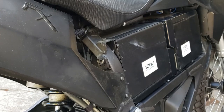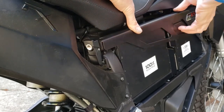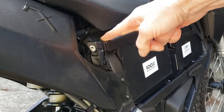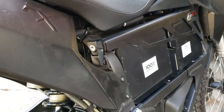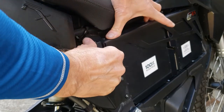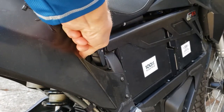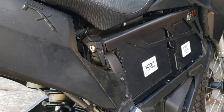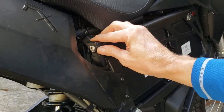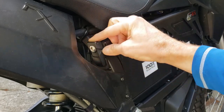Now to reinstall the battery retaining rail, set it in there, push it forward all the way and lift up a little so it goes in the slot in the front. Note that the little cylinder should be protruding from the hole, or it won't fit correctly. Latch the bottom over the little hook and close. Then do a quarter turn counterclockwise and we're done. It's very easy to miss this latch or one of these holes, and you can find that this rail comes right off — that's happened to me. Make sure this is fully latched on.